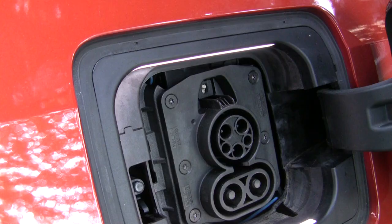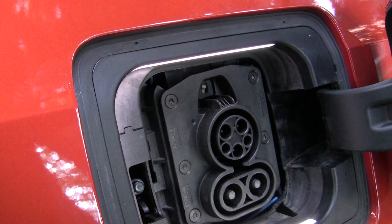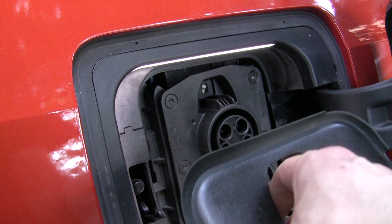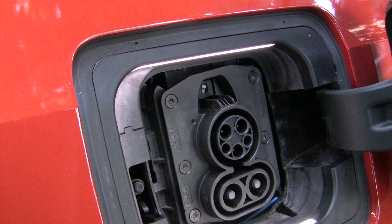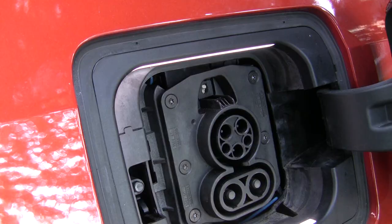I've reassembled all of this, at least electrically. Note that I've left this little shroud out — you put that on after everything else has gone together because this lip needs to go on the outside. I'm actually going to leave this off until I know everything works, and probably until I replace the actuator, because I might be able to service it without taking the entire side off the car. I've reattached the high voltage disconnect at the front of the car, and I'm going to try plugging in power and see if that pin comes out.